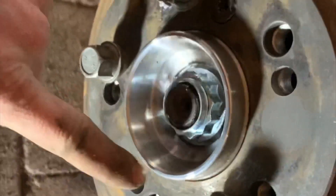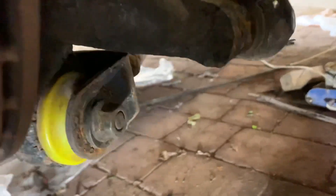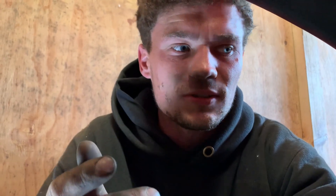So that's it all in. You can't really see it but you've got a lot of adjustment still on the toe bracket — I've just moved it all the way over to the left because hopefully that'll be enough. I haven't got the tires yet for my wheels, and I need to replace my camber arm because I snapped it and had to weld it back up. There's not really much else to show you — it just goes on the way it came off. I will say: put the drive shaft into the trailing arm first, it makes it a lot easier. Yeah, that's the video finished — stay tuned for the next one.